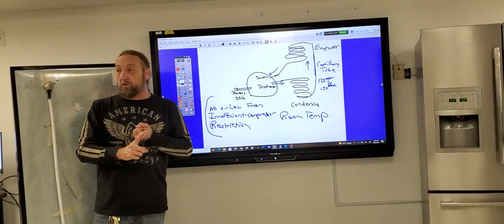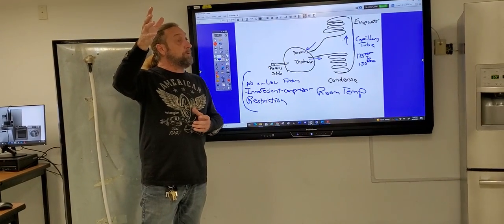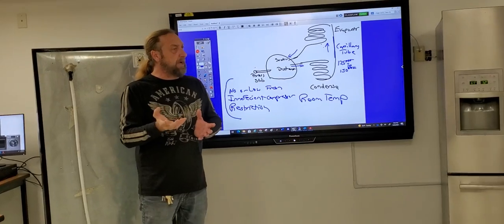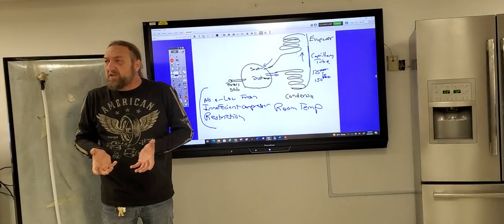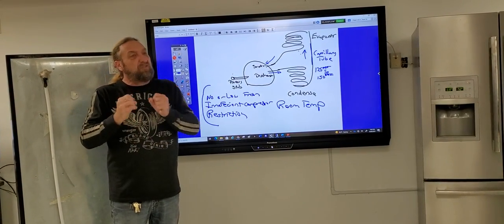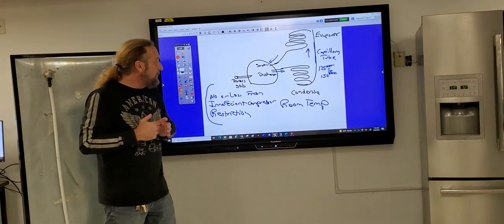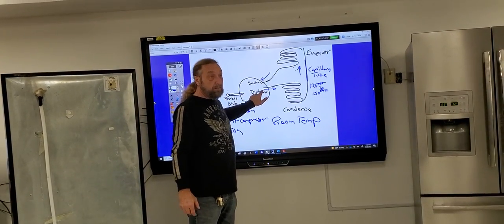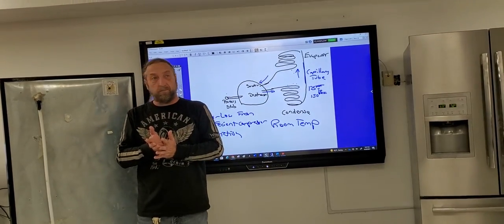We check to make sure the doors are closing. Even if the refrigerator door doesn't close, the freezer will still get cold. If the freezer door doesn't close, excessive warm humid air will come in, frost will build up near the fan, and you'll have some cooling but not proper freezing. If you run into a situation where the condenser coils are room temperature and the compressor is running, you have a sealed system problem. At that point you need to bring out your tools and test. So far, are there any questions on this?